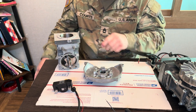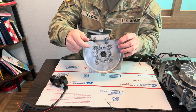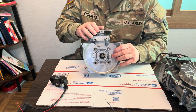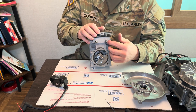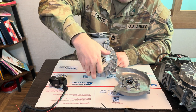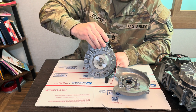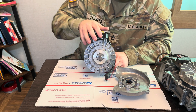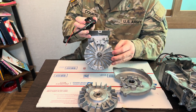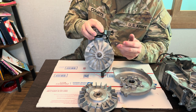Now this is the modern support plate and the modern cylinder block. It's spaced out so that once it's on here, you can see it doesn't have the three mounting points anymore. If you wanted to upgrade to a newer engine, you need to make sure your cylinder has these two points, then you can use your modern support plate. You put on your modern PVL flywheel, and you can see the mounting points are set up for this six-inch flywheel — you couldn't use your vintage flywheel because your coil would sit too high and the flywheel would be too far down.